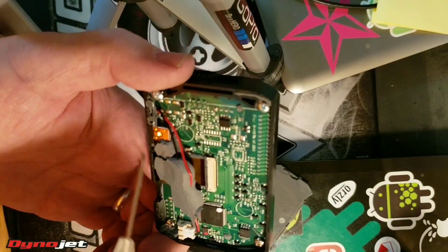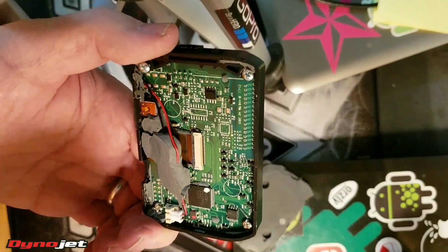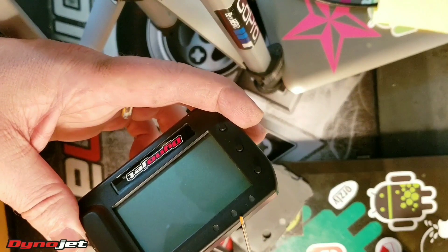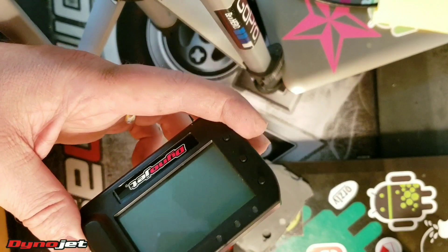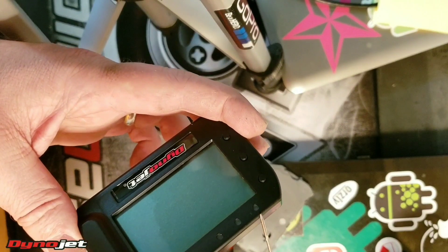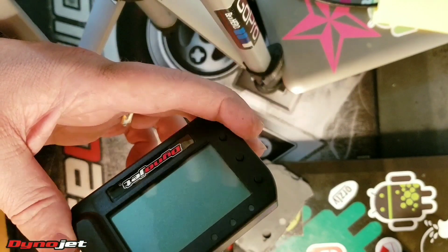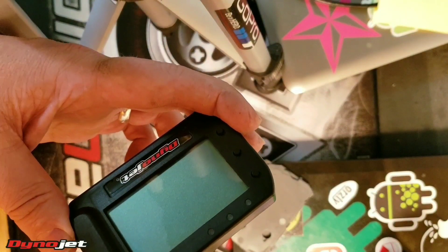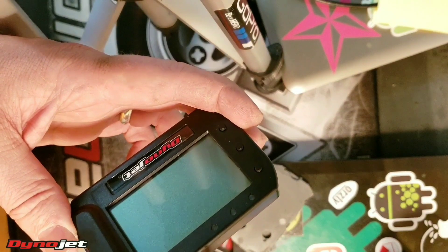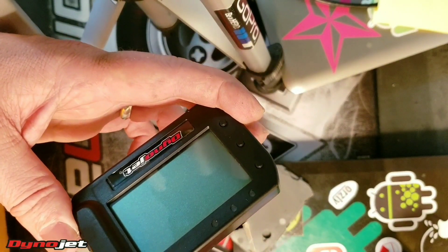If it does work, I'm going to use it. You have these indicator lights that you can program inside the Pod 300 to whatever you want. I'm going to solder a couple wires off one of these indicator lights so we can set it up as a shift light up on the dash — a little brighter than these, because these are not that bright and not super easy to see.